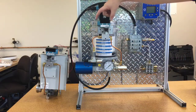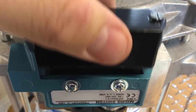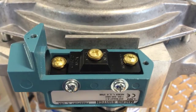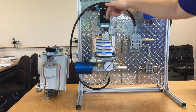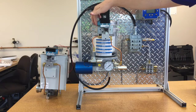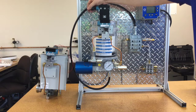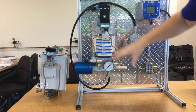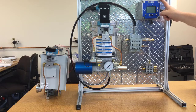Other than that, the only thing we have left to do is hook up our electrical connector. There are just bare terminals inside. Normally you'd want to connect to common and normally open, because then the switch will close on fault when that pops out. There are a couple of screws to remove to get at those terminals. You can either put on a piece of half-inch conduit — this is half-inch NPT thread — or put on some other kind of electrical connector to add a cable. Then you can hook this into your GLC4400, your PLC, or if you're still using a WMP3 you could hook it up to that as well.